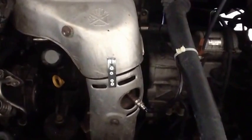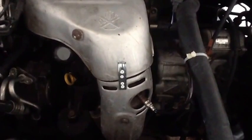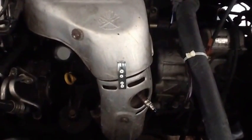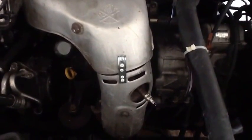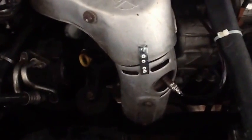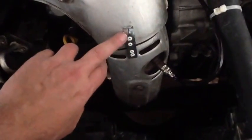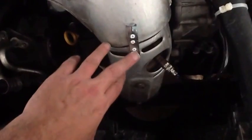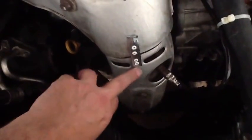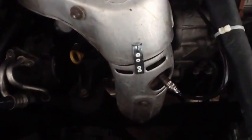I've been driving the car for a couple of hours over about a day. So far the light's gone out. I had the P0420 engine alert that set the upstream sensor on bank one as having problems, so I replaced my air fuel ratio sensor. When doing it, the clamp holding the top of the heat shield broke. JB Weld won't work at those temperatures, so instead I found a bracket and put four rivets in it, bent it so it has a little pressure against the catalytic converter on the bottom. It's on solid — that issue has been solved. Let's see how long this sensor lasts or if it fixed the problem altogether.